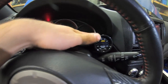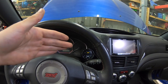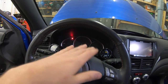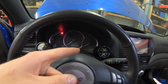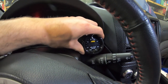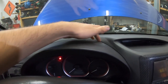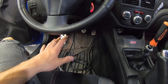That looks great — AFR on one side, boost on the other. You can literally see those while you're banging through gears, your eyes right on those two gauges. I put the big rubber bands on both adapters, pushed the gauges all the way in, and they're sitting nice and sturdy. I pushed all the clips into place, smacked the bezel in a couple times, and it fits up pretty nicely for a 3D printed piece.